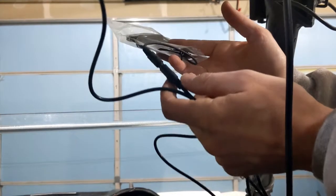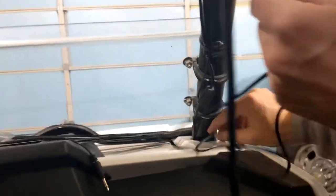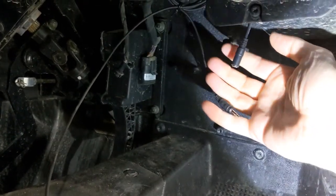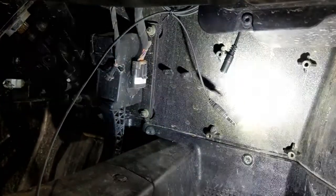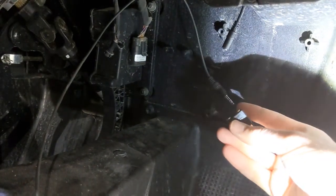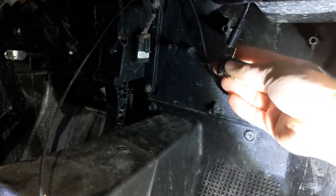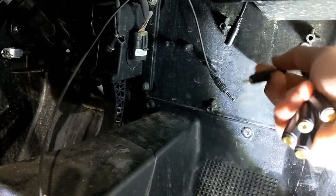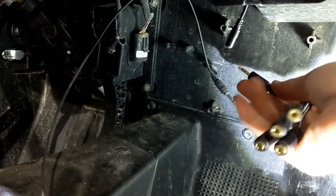With the PTT, we give you an extension cord. Pull the PTT out and feed the extension cord portion down through the hole, then go behind the dash and hook it to the shifter lever. You can see the extension cord running off of there with one PTT plugged in. Unplug it, and depending on how many PTTs you get, that's how many splitters you have — this one splits two. Plug in your PTTs and then plug the splitter into the extension cord. You can run up to four PTTs on our system.